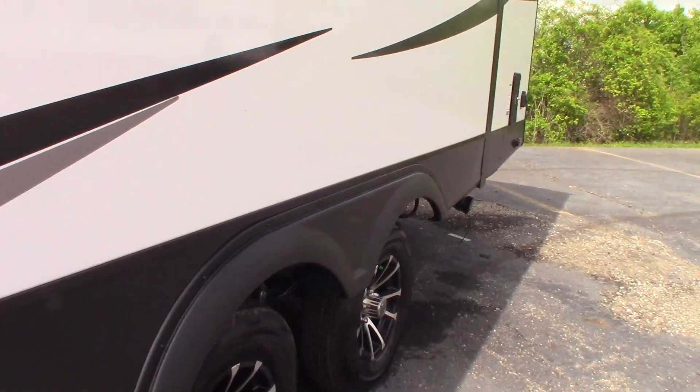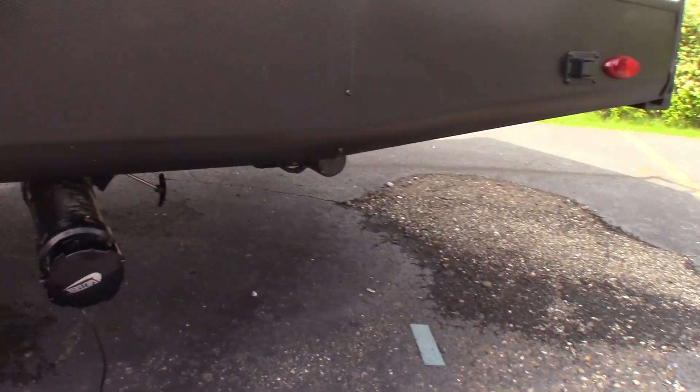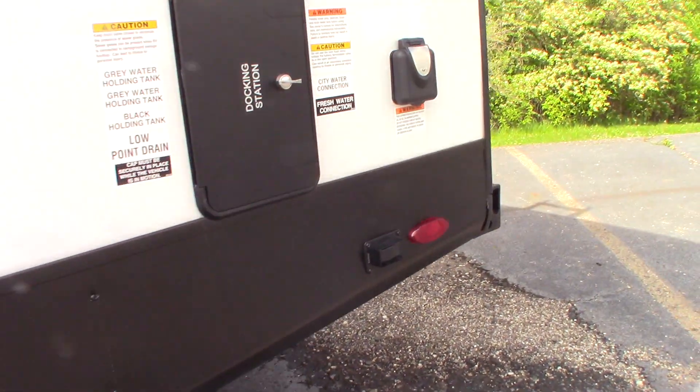So your slide room, which is in right now. This is where you hook your dump hose up to. And then you see your valves back there — you see the gray valve there, the black valve there. The black valve is toilet water and waste.